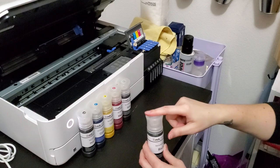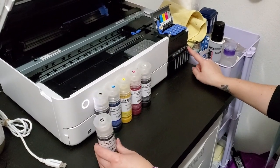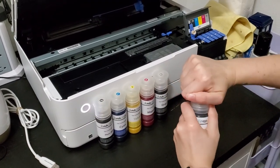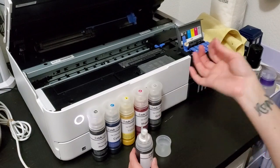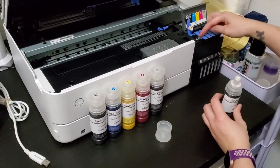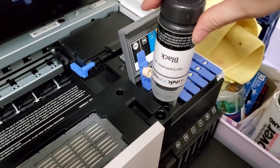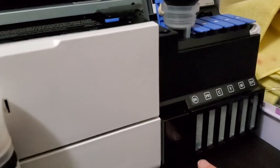I had to open each one of these bottles and had to use some gloves because I'd already gotten some ink on my hand. I have them in the order they're going to go in: black, photo black, cyan, yellow, magenta, and gray. What you do is just twist — what they do is you just have to twist. I already took the metallic foil pieces off the inside and peeled them off, wore some gloves, and used a pair of scissors to cut around to make it easier. We're going to start with the black — you can see that the notches go like this, so we're going to dump it straight right into the cartridge. All you have to do is set it there and it's going to fill. You can hear it filling into the tank.